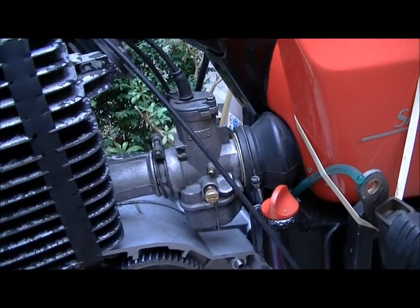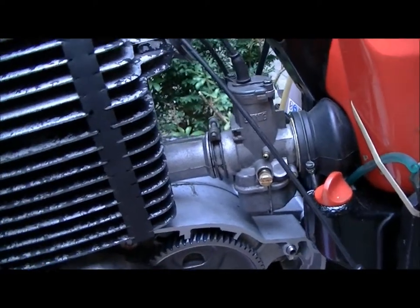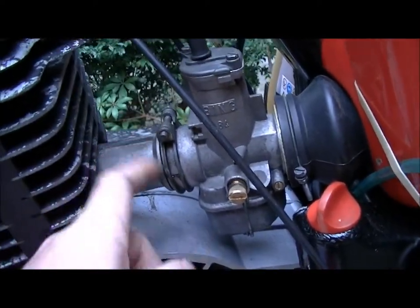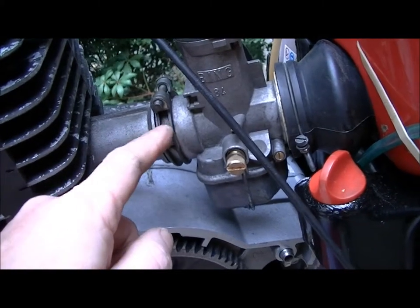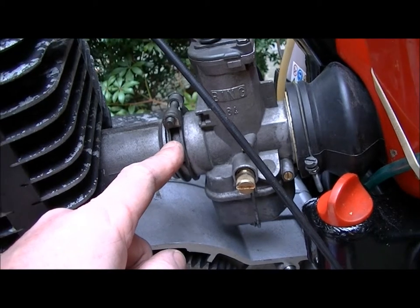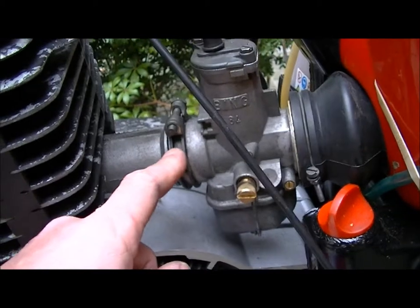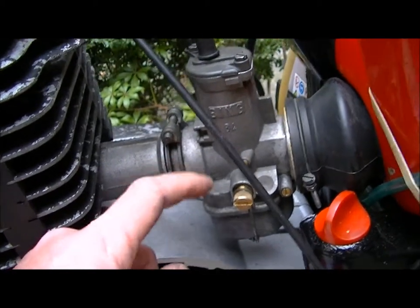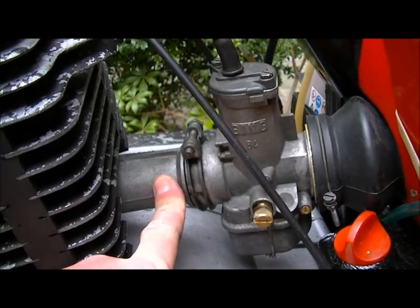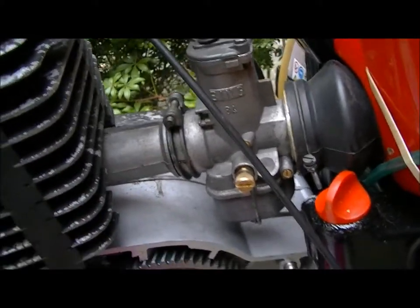If I do the carburettor first I will fail to get this one into the diffuser and to its seating. It's back on. One good tip for those who are interested: lubricate this fitting. I've used some WD-40 and that really helps the process of getting this onto the tube.